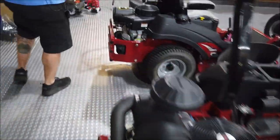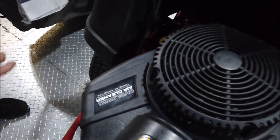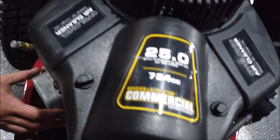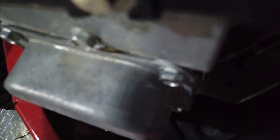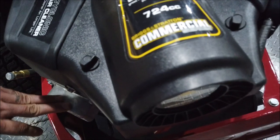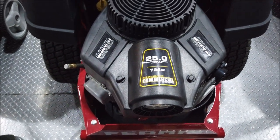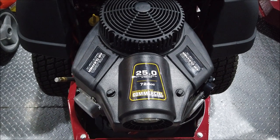On a Briggs, they're on your valve cover 90% of the time. This one's a 44T 977. On your Briggs, we need all of the numbers off of the valve cover — very specific parts to these engines.